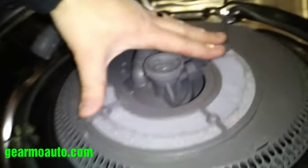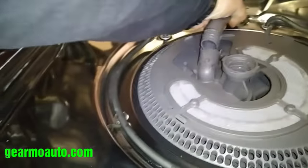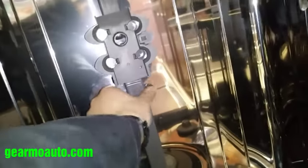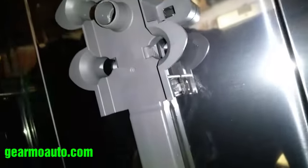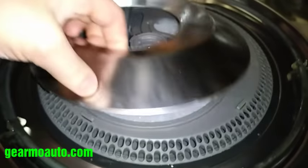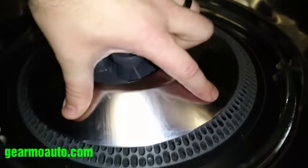Make sure this little tube on the inlet goes to that as well. When putting this back on, put this part in first — hopefully nothing broke and it'll just pop back in place. Make sure the little tabs line up with the other tabs, then get this back on the back of the dishwasher and make sure it pops in place. Now this piece goes on — the opening will go right here for the tube so it's not clamping down on the tube line.